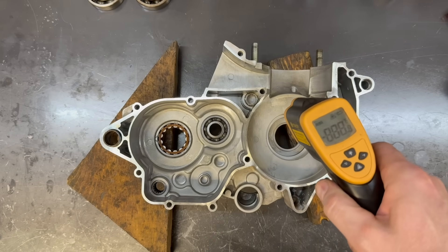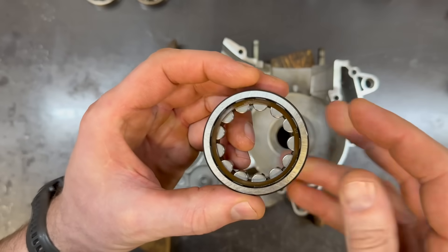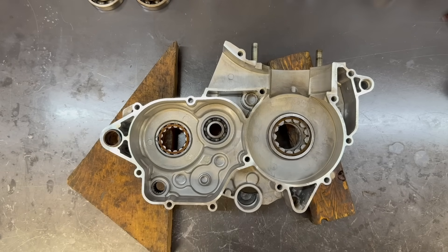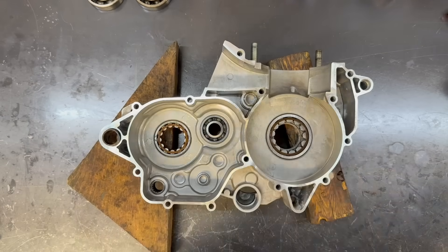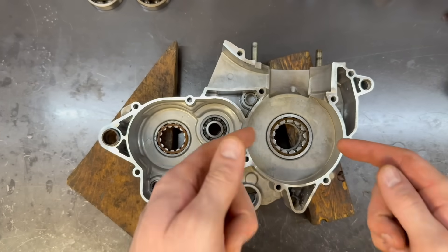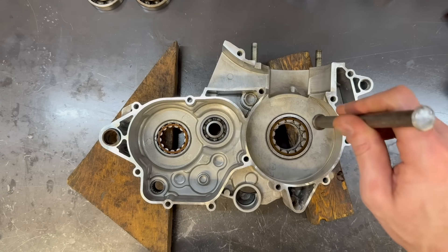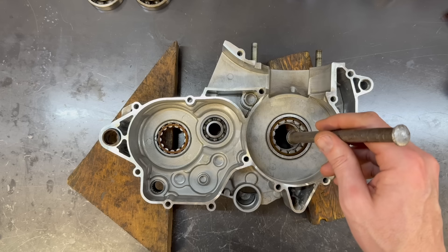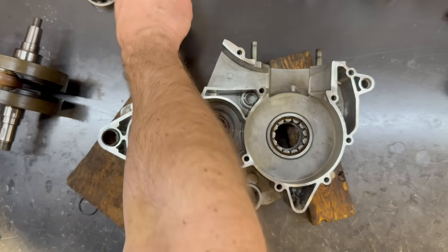I've been monitoring the temperature. This particular bearing has a lip right here — we don't need that lip, so I'm going to put the lip down. We're a little on the tight side and I can't find my hammer. I should have had my hammer ready — if I had it quicker I would have been able to knock it down easier with only a couple of taps. It's good to show you that because realistically it may happen to you. You saw that I was going around it — what you don't want to do is hammer it in on one side so that it goes cockeyed. You're going to ruin the case if that happens. Take your time, go around, and when you hear that 'ting ting' sound you know it's seated all the way.